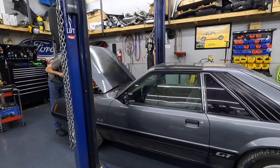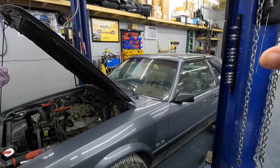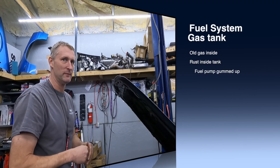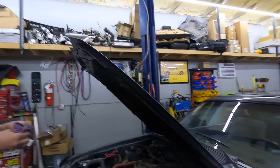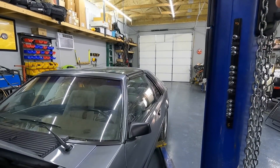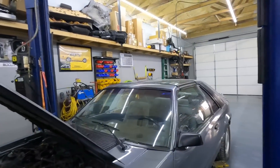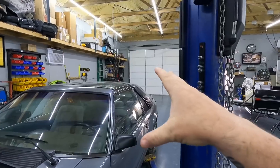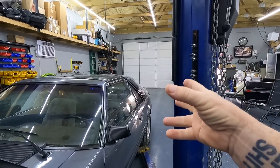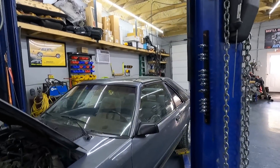We're using Cory's 85 GT as our specimen — this car sat for a good 20 years. First thing: the fuel. The gas was bad, the tank was rusty, so he had to put a new tank in. If a car is sitting for a long period of time there's a good chance the tank has rust inside it, or the gas has turned to sludge. So the very first thing is to drop the tank. You're probably going to have to put a fuel pump in as well, because they'll sit there and gum up and freeze up.